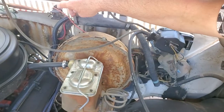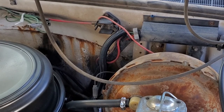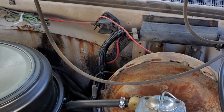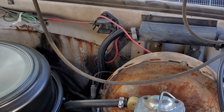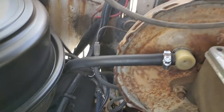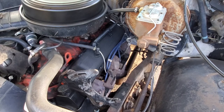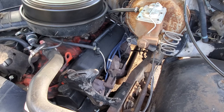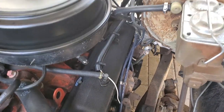Next up, we have a green wire right here. This is the wire that comes from the instrument cluster for the coolant temperature. That green wire was cut off by the former owner back by the firewall — we don't know why. We had to find it and put a new end on it. The new end is the white wire down here going to the temperature sensor. Green is the correct color, so for a true restoration you'd want green all the way down. I think I'm probably going to have to replace the temperature sensor as well. We also added the plastic wire loom and clamps on top of the valve cover to run the wire down.